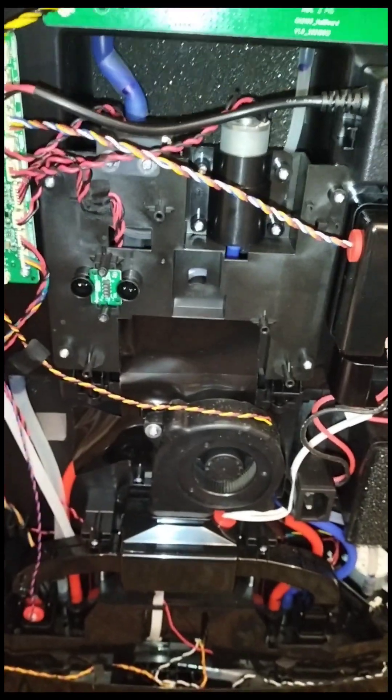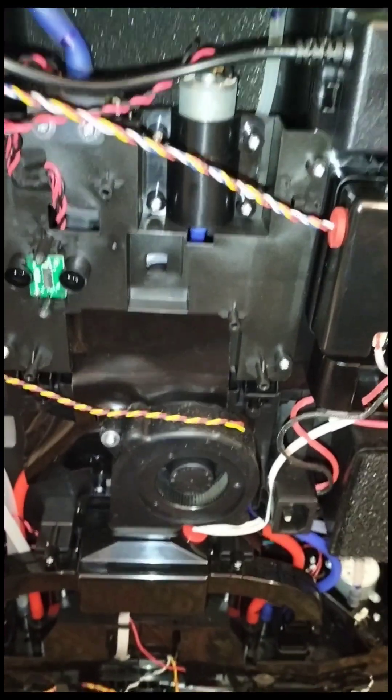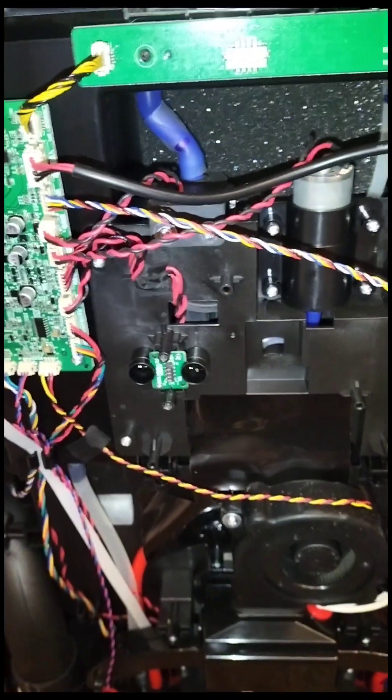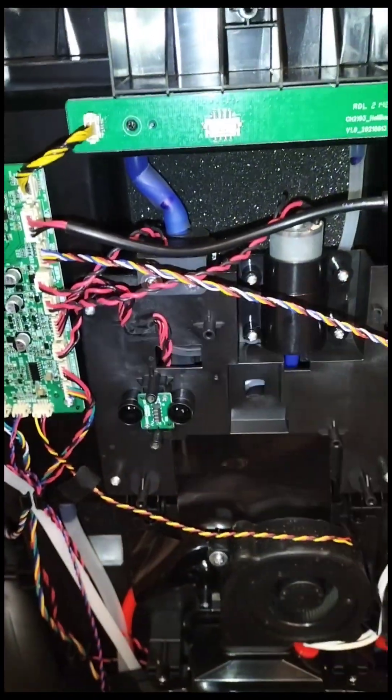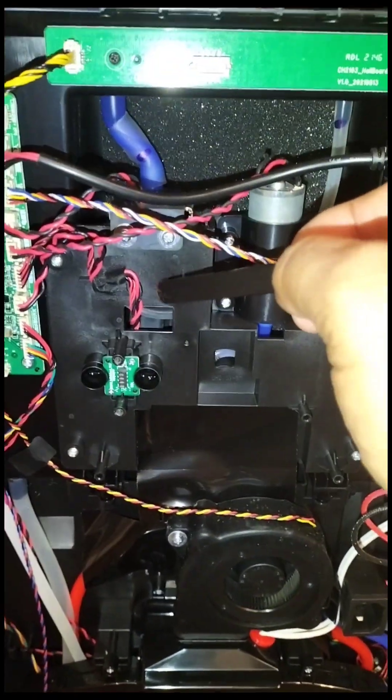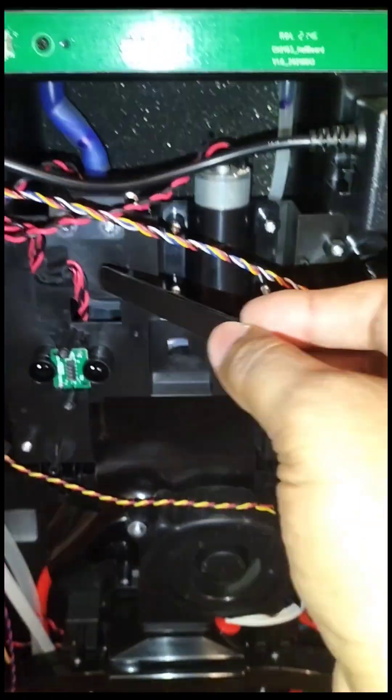When you run the deep clean, you can hear the sound of the pump. If the pump is working, nothing is wrong with the pump, and the solenoid valve will also be okay if water is going down. If water is not returning back, it is always because of the rubber seals of the water tank, or maybe because of the motherboard. If the water is going down, the solenoid valve is working — nothing is wrong with the solenoid valve.